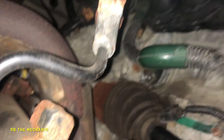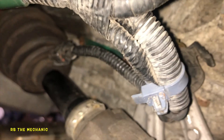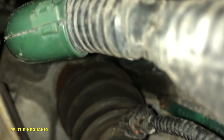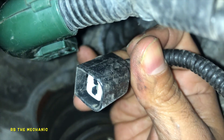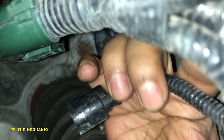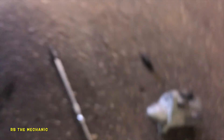Let's look for the harness. You can see this connector right here on the axle boot — that is the one connector. This is the one you want to check power on. This is the control cable; when you turn the key this gets power and it activates the solenoid click. The big cable carries the 12 volts that actually turns the starter motor. Those are the two cables — the control is the only one you want to check signal on.